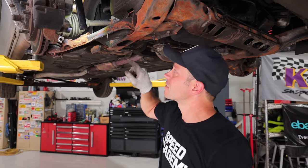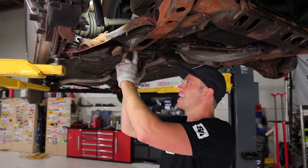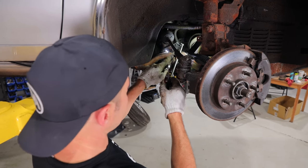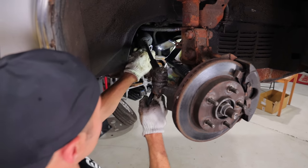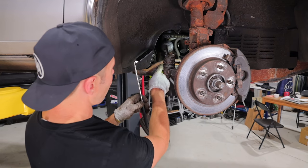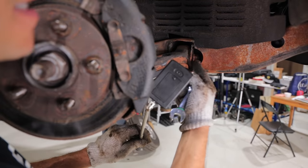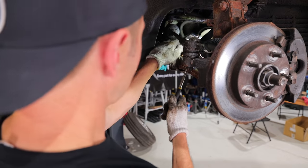However, there's a peculiar thing going on here. There's a bolt in here for this side of the control arm but there's no access to the nut. I thought pulling the sway bar off here you'd have that. Well, like a real genius, I didn't check up top to see if there was a relief for the nut to access it. And of course it's there, except you can't get a wrench in here. In the 80s you'd think somebody said, oh, let's just cut a relief right here and it'll be so much easier to access. Look up front — look how easy that is to access there. I've already loosened this guy because they cut a beautiful relief. But in the rear here, they're like no, we're going to make you fight for this and curse and swear.